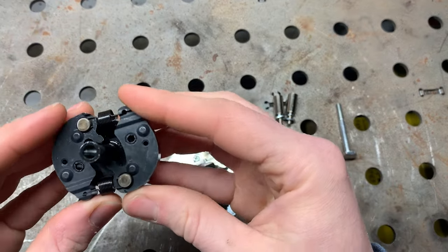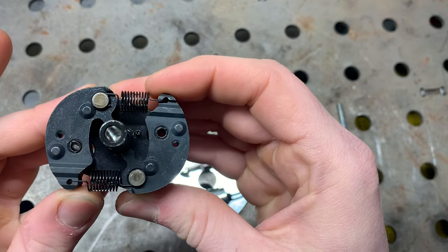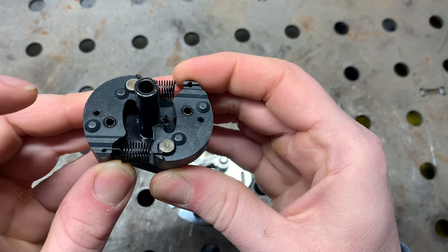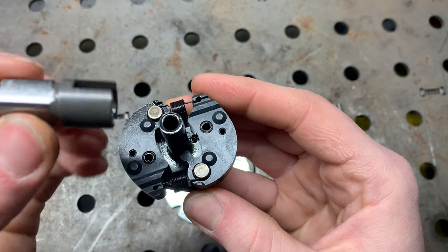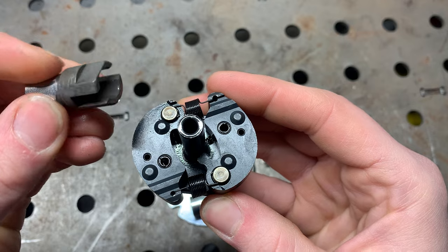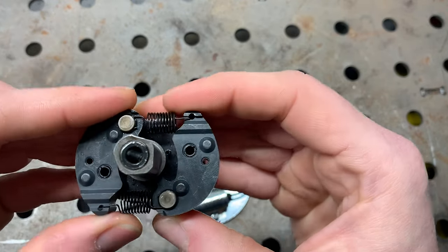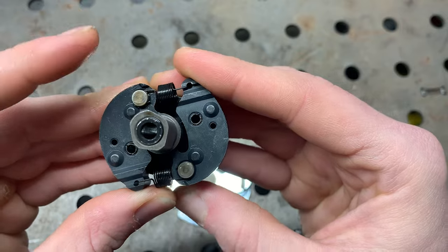This right here is your mechanical advance. As the motor spins, the weights on these springs change the timing — the centrifugal force of this thing spinning is what opens the weights up. Right above my fingernail you can see a little pin. This is your cam lobe, and it's got a side with a flat — that's a cutout for that pin. When you put this in, you have to orient it so the pin is on that cutout. If you put it in wrong, you're going to bend it and your bike won't run right.